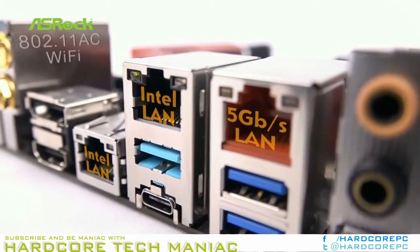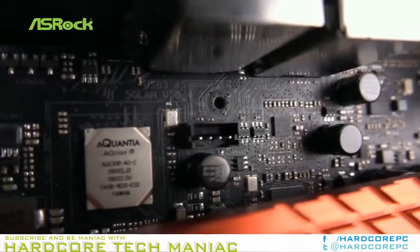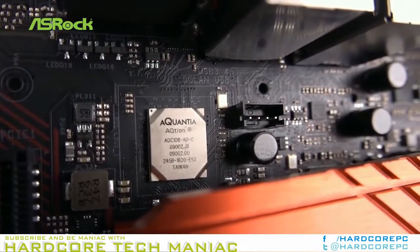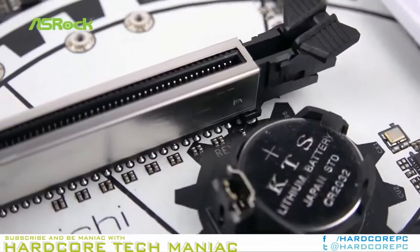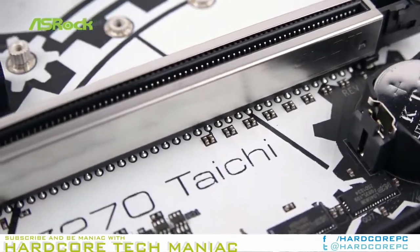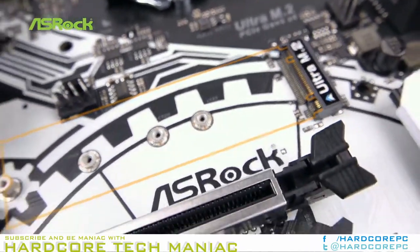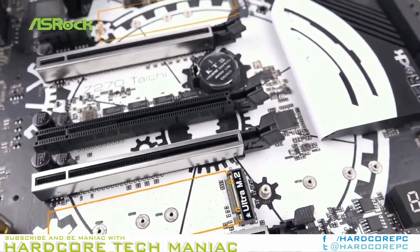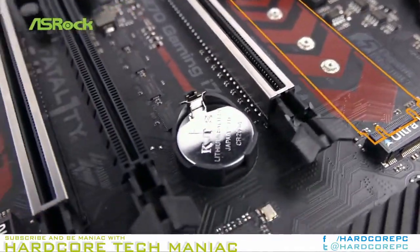There are 3 M.2 ports that work at the same time as the three metal-reinforced PCIe X16 slots. There's still no panacea when it comes to Intel's PCIe resources, as the Z270 Taichi still supports a maximum of 24 PCIe lanes plus a few SATA and USB 3.0 ports. ASRock gets around some of those restrictions by relying on the CPU's separate PCIe 3.0 controller for all three of its reinforced slots.